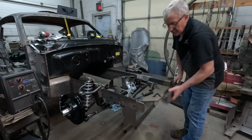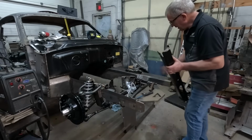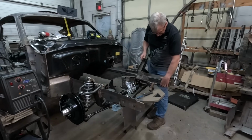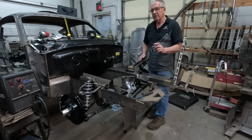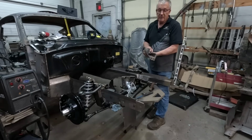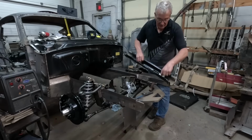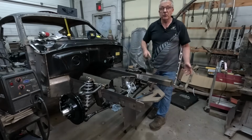What that does is this pops over the ends of the chassis rail and slides on like so. But one of the little tricks of this is that these chassis rails are made of 2 by 3 inch steel beams. And the original Mustang is 2 3/4 deep by 2 inches. So I came to realise, I was going to try and put it on, it wouldn't fit because the gap in here was 2 3/4, and it's got to slide over a 3 inch rail.